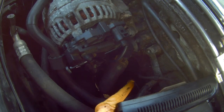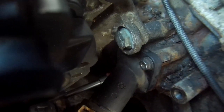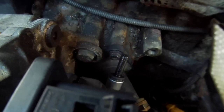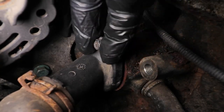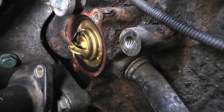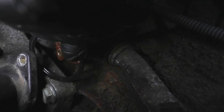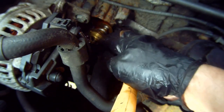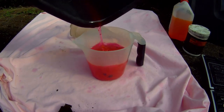Make sure your bowl is underneath, and try not to drop the bolt down the engine. The top bolt I found I could just use the wrench. Once you've exposed the thermostat, you just need to take the seal out, and then the thermostat just comes out. Some more coolant will come out of the engine block along with a few bits of corroded debris — another 600ml.